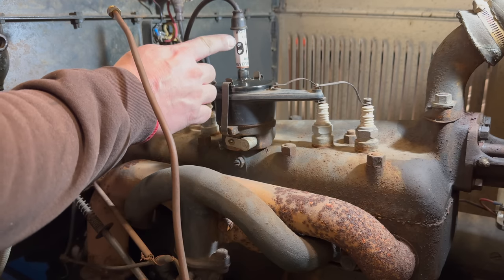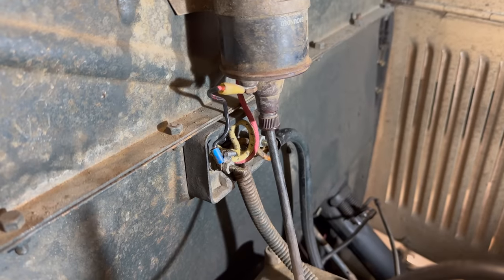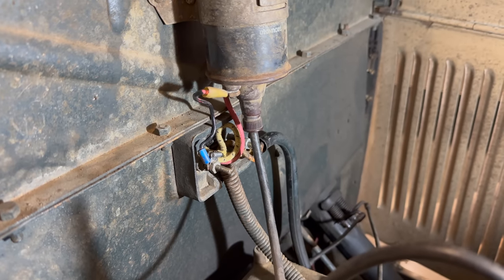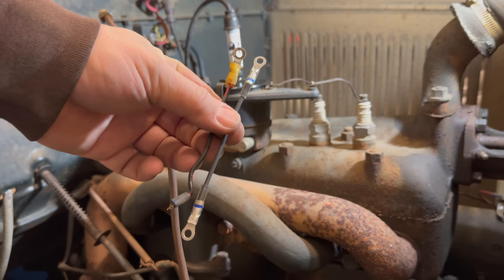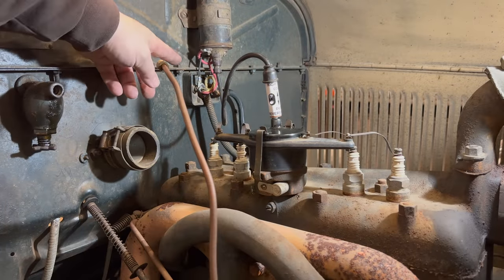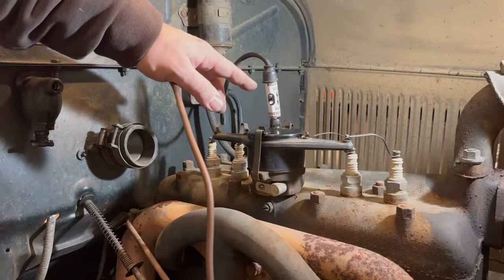I need to reverse my wiring and then we'll try it again. This isn't a huge surprise because on the wire diagram at the junction box, things are wired backwards from the way I have it here — but that's the way this car was wired, so I was giving the previous owner the benefit of the doubt. Obviously this is wrong, and if we hook it up the correct way the car will run even better. When reversing the wiring on the coil, one of the terminals on the negative wire broke off, so I ended up making a new one using proper terminals with heat shrink — these shouldn't break. With the wires reversed, let's turn the ignition on and see if the top one flashes this time. The top one was flashing and the engine runs.